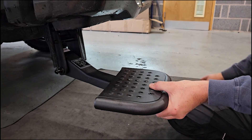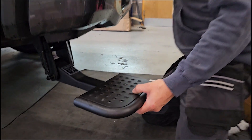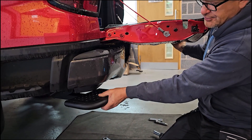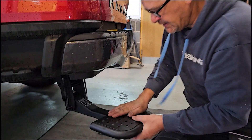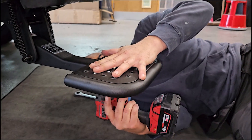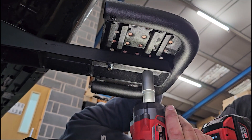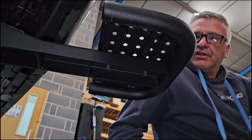Find the position that suits you best and then run up those nuts. You might want it at an angle so that when the tailgate's down you can step on it cleanly — that looks like a better angle there, and it's going to fold up neatly out of the way. With the impact gun, and no need for a spanner since they're square-headed bolts, just get it nice and central and nip those up. And that's it — step attached.